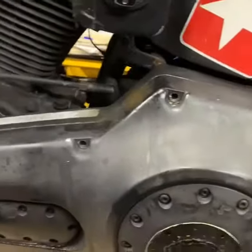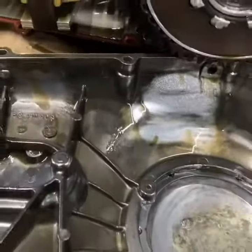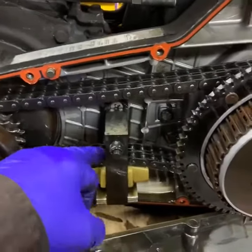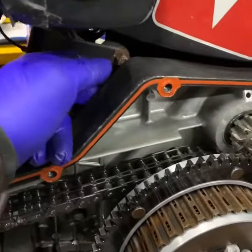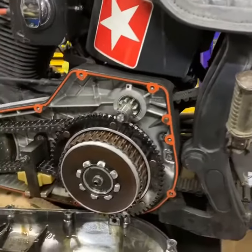This job here — your primary cover, taking all the bolts off. As you can see, there's quite a bit of metal in here, quite a bit of metal on this as well. So basically we're going to strip all this off — a lot of rust as well. We're going to take the primaries out, see your tensioner working there — he's got an automatic one in actually. And this particular seal behind here on the gearbox and the tranny, we're going to change all that as well.